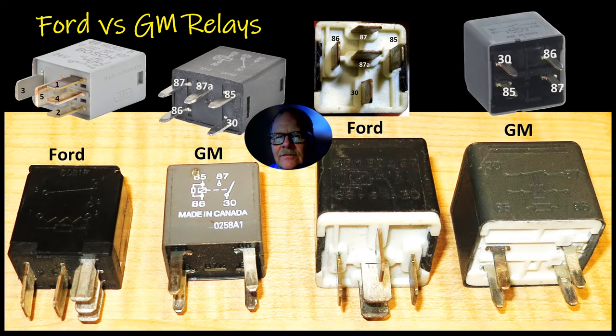Now these are your relays. This is a Ford relay, which is like a Bosch relay. Ford and Bosch are very similar. But the terminals and configuration are numbered. These right here are all mechanical relays. The pins are numbered 1, 4, 2, 3, and 5. Pin 3 is the common terminal. Pins 1 and 2 are your coil. These two are typically the load-carrying terminals. This one will be hot all the time. When the relay is not energized, whatever's coming in here will be coming out pin 4. But when you energize — ground 1 and power 2 or vice versa — the power coming in here suddenly jumps and starts coming out the other terminal.